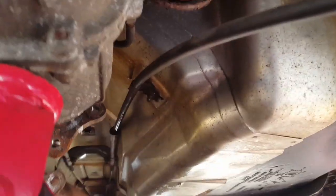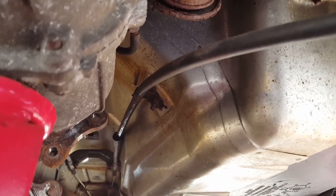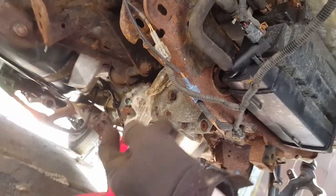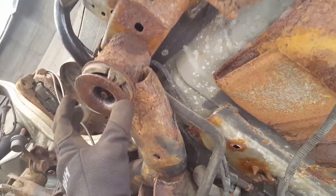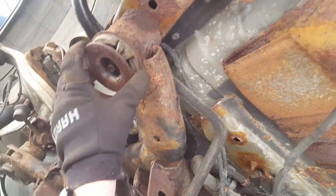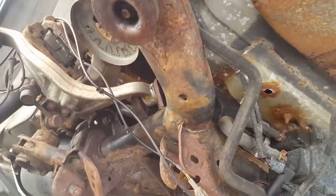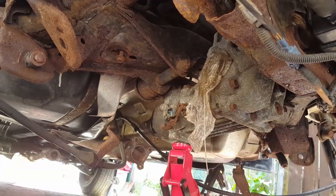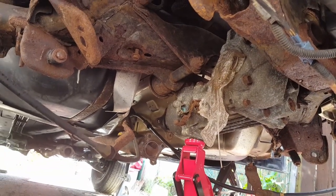The second one just started spinning in place, so I'm going to pop it out of the heat shield similar to the first one — I'll just take a chisel and shove it in there. I was able to rip off that second bolt for the brake line, and now we're on to the last two bolts holding the K-Frame in. This bolt's pretty loose already — you can see this circular piece. I'll have to reuse it on the new one since it didn't come with that. It's coming out pretty smoothly. I do have this supported — I'm not sure if that's the best way to support this, but I think it will be okay because it's kind of in the center.